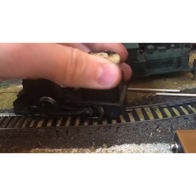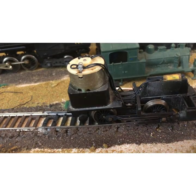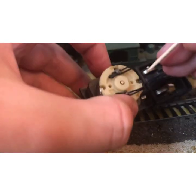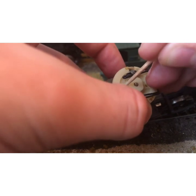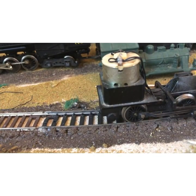Attempt to bend inside. Two sides, all right. And basically what I've done is I've put the two brushes around a little post. There's these holes right over that, which if you push down, it pops the brush up over the post and into place to allow you to easily put the motor back together.